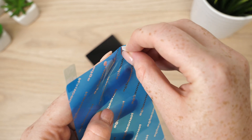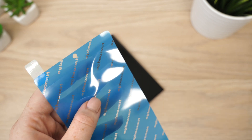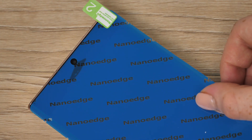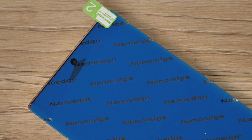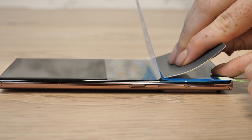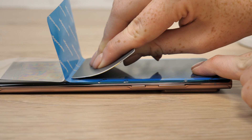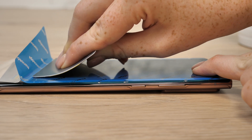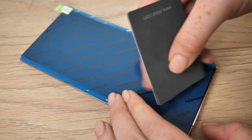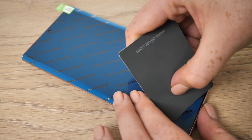With cleaning done, we can now turn our attention to applying the film. Pull back the tab labelled 1 — this will expose only a small amount of the adhesive. Carefully match up this area to the top of your handset, using the front camera lens to help you align it. Then run the application card smoothly along the film whilst holding it horizontal, allowing the film to seamlessly detach from the plastic and attach to your phone's display. When completely attached, use the application card to firmly wipe over the film to make sure it is fitted securely.